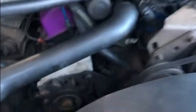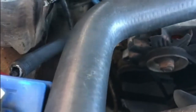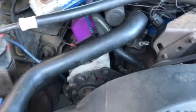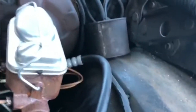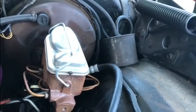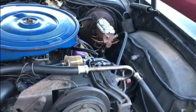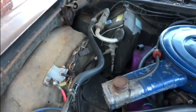We don't need any of that. Down at the bottom of the engine, just there where my finger is, there's a pulley that belongs to the smog pump, which is totally seized. It's not connected, there's no belt on it, and the pipe that comes off the back is just hanging down — it's doing absolutely nothing. I'm going to find a way to remove all the emissions bits and pieces, and there's also something that looks like a giant tin tuna — I've no idea what that is, but if anybody knows, leave a comment below.